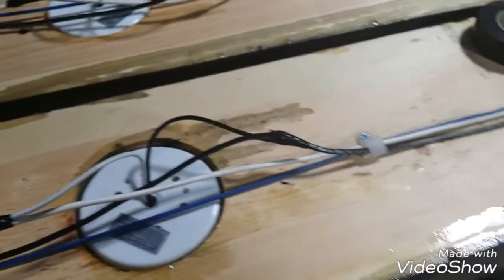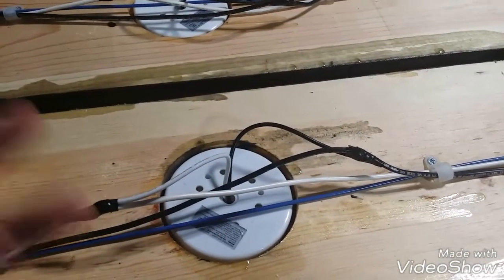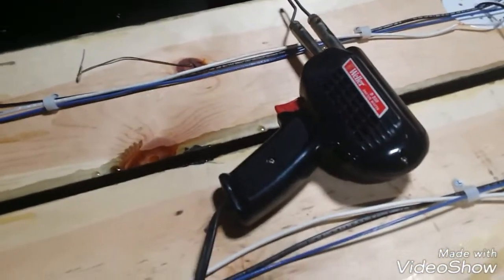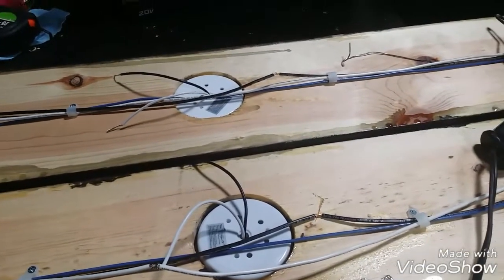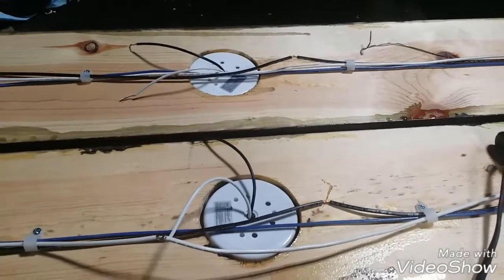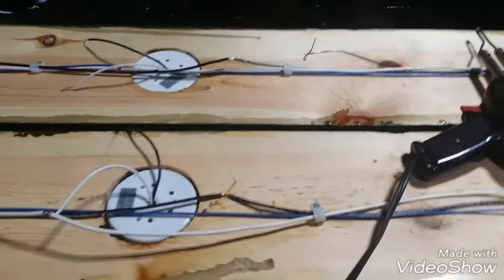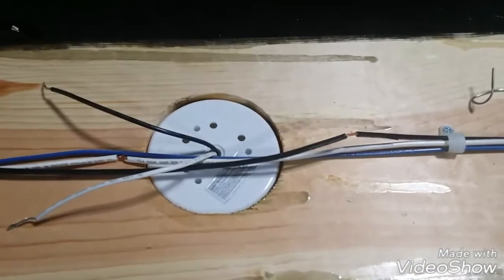Mine will last longer. If you ever need to replace it, you're going to come in here, cut it, replace it, and solder them back. In the long haul, it's cheaper. You get a roll of solder and a decent solder gun, and you're good to go for a long time. Or you can keep buying those crimp-on connectors. Not so bad in an interior environment like this, would probably work out just fine. But underneath your rig, trailer lights, engine compartment, all that stuff, I'm a solder guy. I'll convert you all to solder guys if you'll let me.